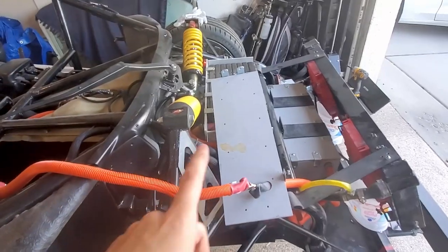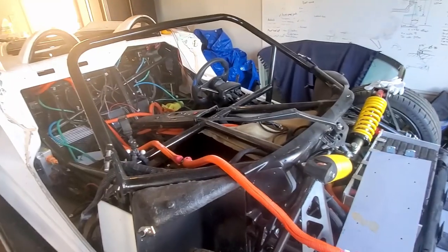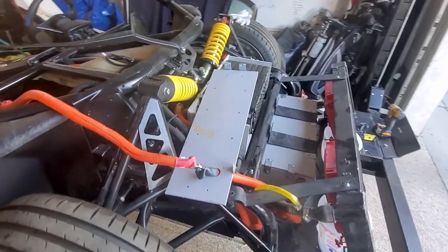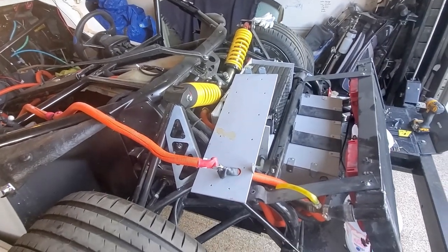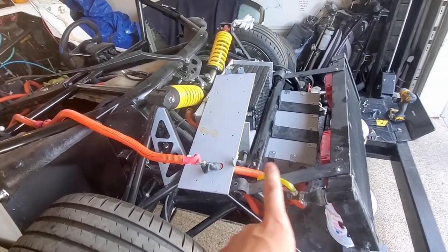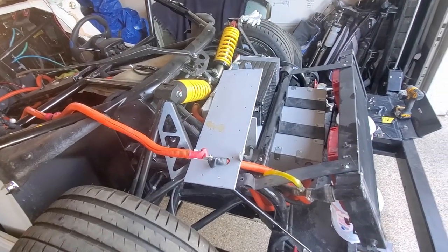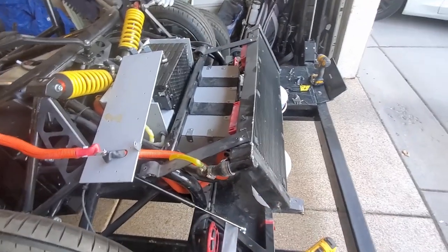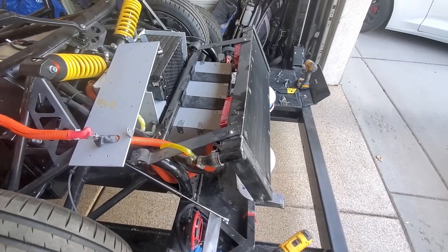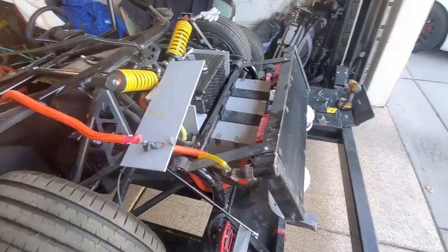All right, so I've disconnected just one, battery module 4. I still have the 3 up front here, and did another isolation test, and we're still not over a million ohms. It went from about 0.5 to 0.8, so it's improving, but I'm thinking each battery module has just a little bit of issue, because of what we've seen. I've got my radiator on some ice cream buckets, but I'll probably need to take it off. I need to drain some coolant so I have better access to these front battery modules, and then keep going.